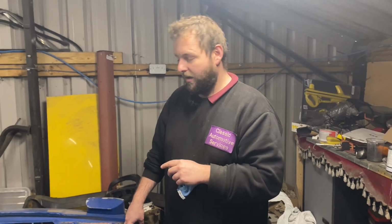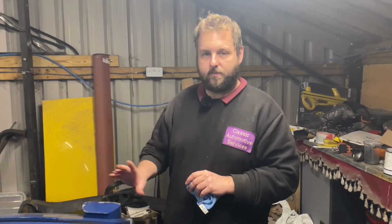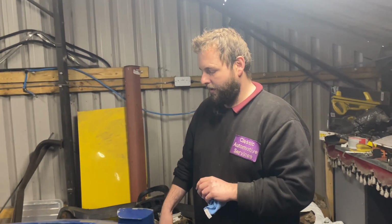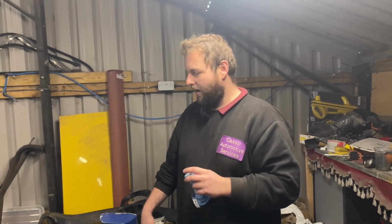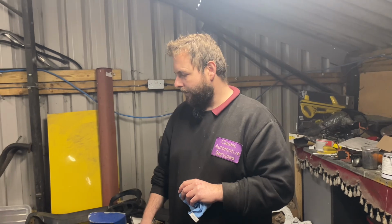So if anyone's interested in a 2-litre TR7 engine, yes, it is American spec, but you can quite easily put the UK spec twin carbs and UK spec exhaust manifold on it. It is slightly lower compression than a British engine, but that's actually a very good, sweet engine, and I don't think you're going to really notice that much difference in it with twin carbs and everything on it. The brake horsepower figure, you really would struggle to feel the difference.